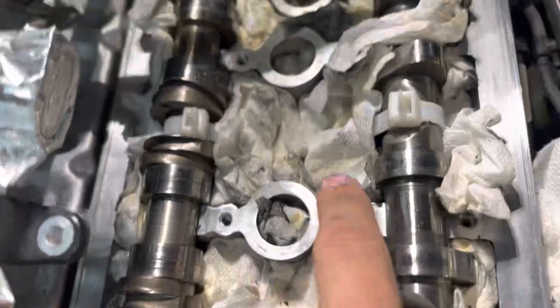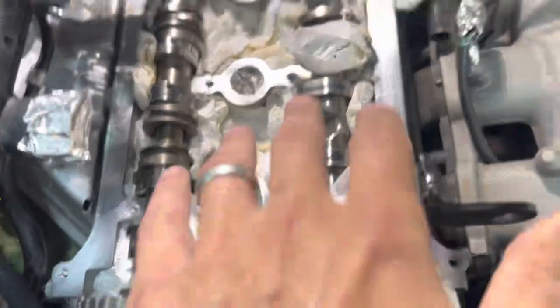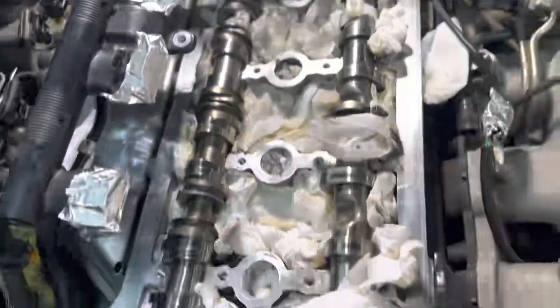This is completely clean now. Everything is cleaned — I use an assortment of sandpapers and razor blades. Do you see all that gasket material that's all over? All that would be down in there if it weren't for these papers. Now with a vacuum I can carefully take out the paper towels, also one there for the oil separator, and then vacuum it lightly, and then you can install the new one.